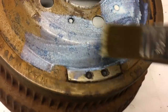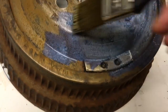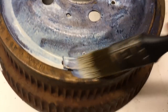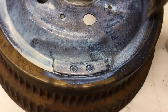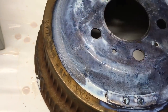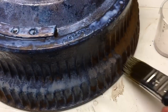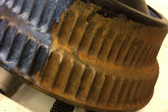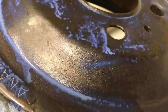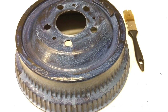You need a very, very thin layer of this. As it reacts with iron oxide — the red rust — it turns black. There are different brands of these rust converters, and I'll review the differences in a separate video. You can also Google the subject and find that some are more efficient than others. Normally you apply a first layer, wait 15 minutes, then do the second layer. Here you can see how effective these rust converters are — it dries up very quickly. I'm going to let it sit for 15 minutes and then come back.